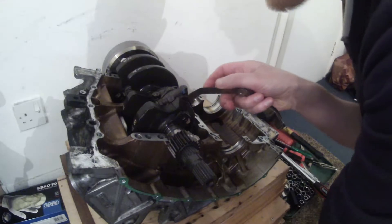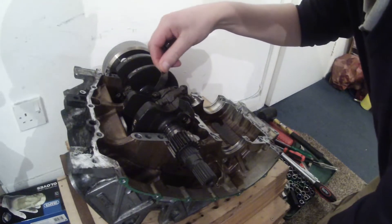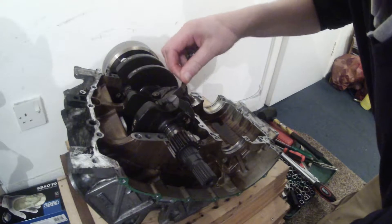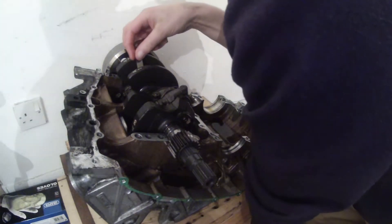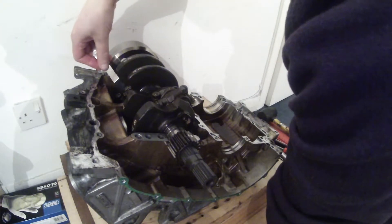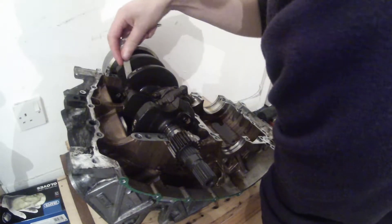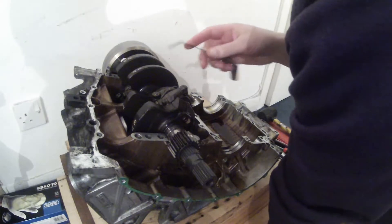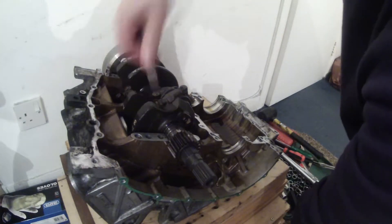That blade doesn't go in anywhere there, it doesn't go between them, and it doesn't go alongside there. That's actually a slightly smaller feeler blade and it's not going in anywhere, so there's no problem with those conrods. I'm going to do the same thing with these two. There's an ever so slight movement in that conrod, just very very slight, but the feeler blade doesn't go in. I'm pushing quite firmly and it won't go in. Same with these — it won't go in anywhere. So it looks like it's fine, doesn't seem to be a problem there.